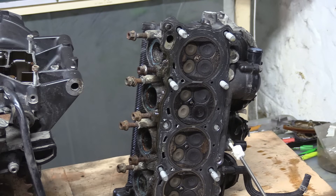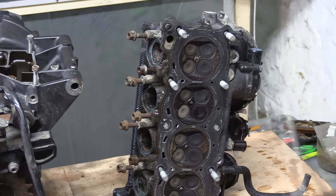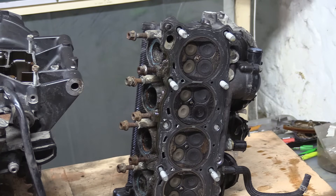The coolant temperature sensors are in the head, and the thermostat is here. I think this is a regular cooling system, possibly an upside-down setup where coolant goes into the head first and then the cylinders — they try to cool the head first and the cylinders secondly. You could see in the block that all the coolant had gone jellified. This bike is a 2010 model, so it's been sat for about 15 years — the coolant's probably never been changed. The propylene glycol crystallizes and turns to mush, but we'll flush it all out and it'll look brand new.